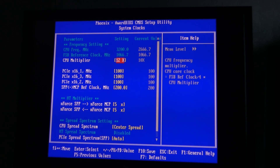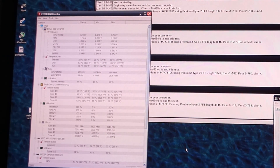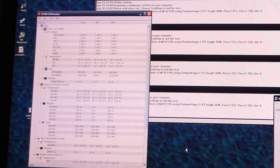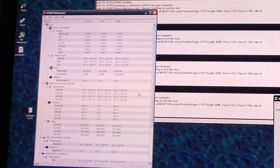I could push it farther if I wanted to overclock the front side bus, but I was just increasing the multiplier, and 3.2 gigahertz is kind of where I felt comfortable leaving it. The one issue is that I had to leave the voltage on auto. When I set a specific voltage in the BIOS, upon booting the computer the voltage would drop off significantly, and especially under load it would drop a lot, causing the system to crash because it doesn't have the voltage it needs to maintain those clock speeds. Leaving the voltage at auto seems stable, and it's not putting the voltage over about 1.325 volts, which is about where I was going to set it anyway for the overclock. So it seems to be working fine — it's stable, and the temps never got above 80 degrees Celsius, even with a full Prime95 all-core workload, so I'd consider that pretty acceptable.